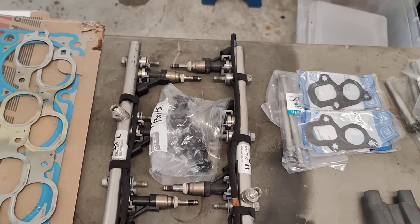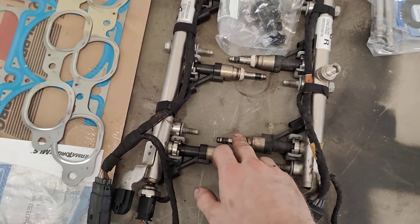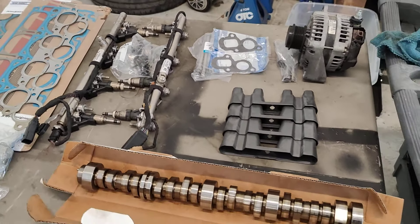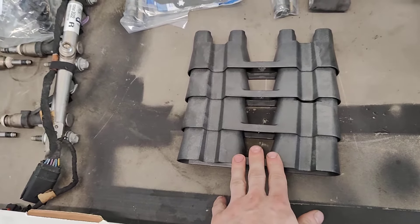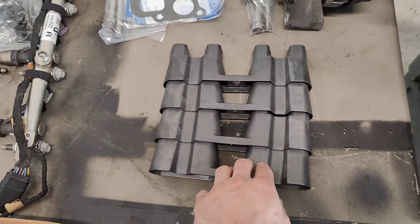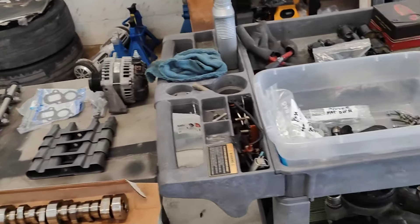Fuel rails are good. I took a look at all the injectors — it doesn't look like we need to do any service on the injector seals, though I'm replacing a couple of missing rubber boots to make sure those are sealed up. We've got new gaskets for our water pump as well. New lifter trays of course — you always want brand new lifter trays anytime you replace the lifters. It's a wear item that will cause your lifters to walk on the cam and cause a lot of problems, especially with aftermarket camshafts.